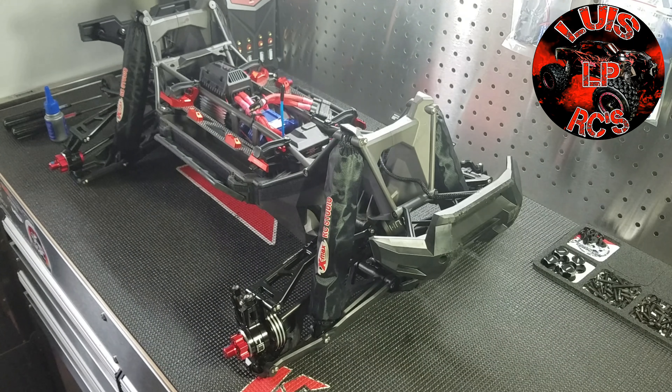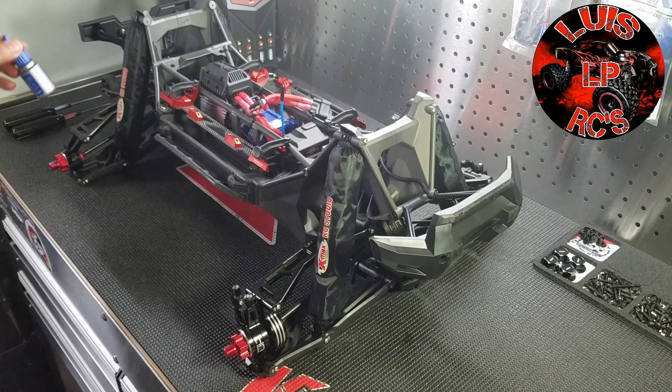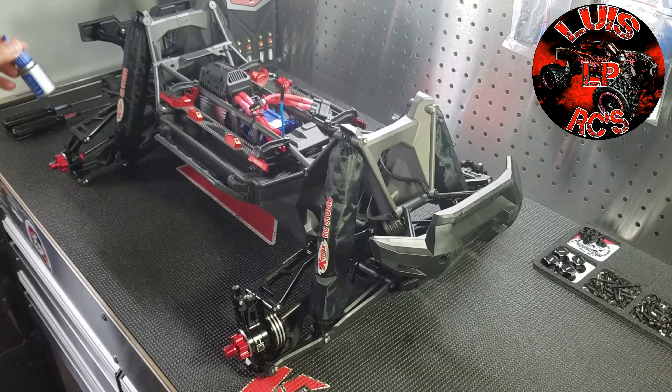You're going to need some Loctite if you have aluminum parts. My whole suspension is aluminum so I'll need Loctite. The only thing that's not aluminum is my lower arms, and I'm not changing those. If they break, I'll replace them with plastic ones — there's no sense in doing aluminum lower arms because if I crash they'll bend and it's a pain to fix. Those of you who saw my Fortech crash know I bent one of my lower arms.